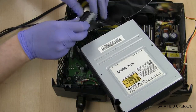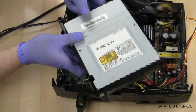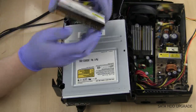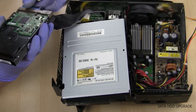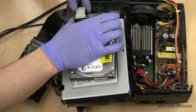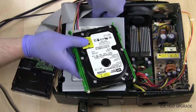If you're using the SATA drive, go ahead and get your IDE cable and plug it into the motherboard as well as the DVD drive. You don't have to worry about folding it yet. Take the longer end of the IDE cable and plug it into the original Xbox hard drive which is set to master. Then take the splitter cable and plug it into both hard drives. You can lay the second hard drive on top of the DVD drive. At this point, your second hard drives are only plugged in through power only.